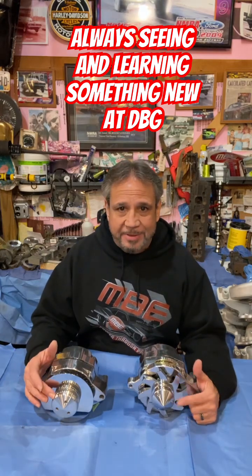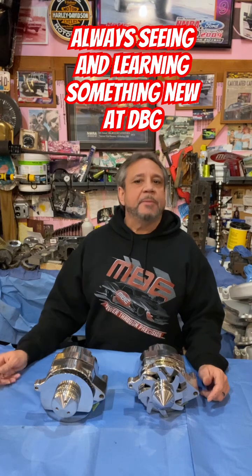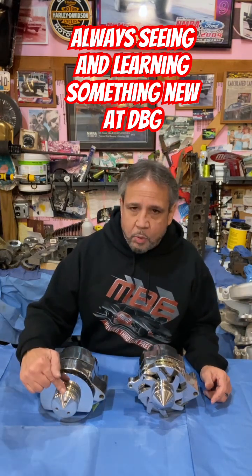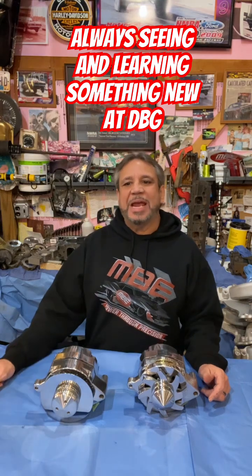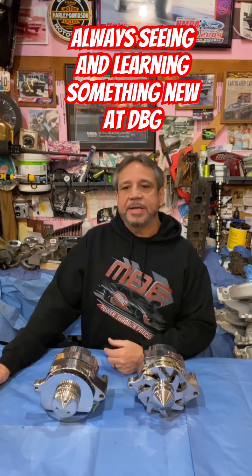You can tell here that this pulley is bigger than this one. So if you do the math, my crank pulley is 5.45 inches and this alternator pulley is 2.34 inches. When you do the math, it comes out to 18,720 RPM at the alternator if you use a max engine RPM of 8,000 going through the traps.